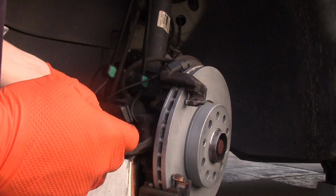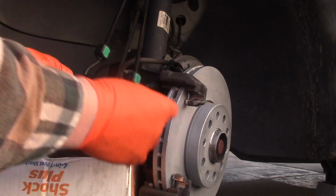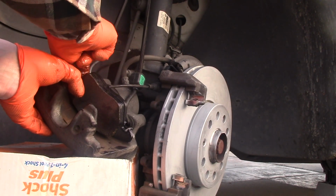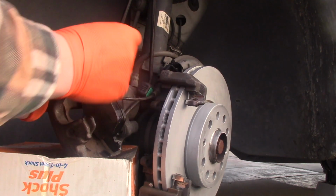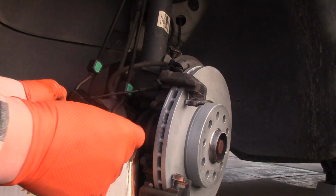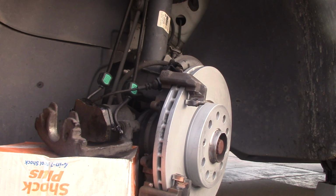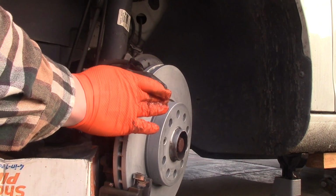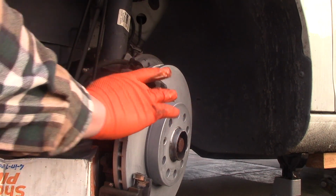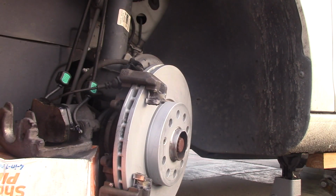Okay, and finishing the lubrication over here. I'm adding lubricant on my fingers instead of a little brush. That's easier for me. Lubricating the ears of the pad, like so. Okay. Now it's time to lubricate the slots. That's where those ears go. Okay, which one? Let's start from top right. All right, adding here. The bottom right.